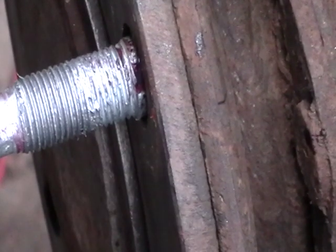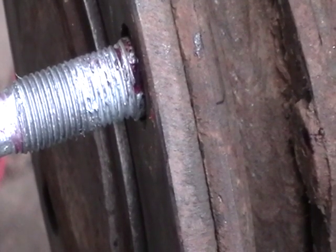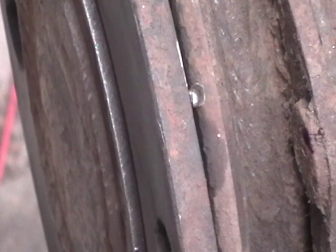I'm gonna bend that a little bit. That's what you gotta do — just do that on all of them, and that's how you put new studs on. Then I'm gonna go on the opposite side and see if I can make that a little bit better, which will straighten up the backing plate because it's a little bit off.